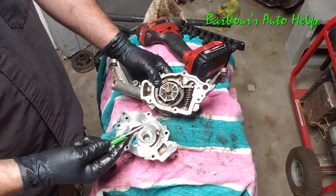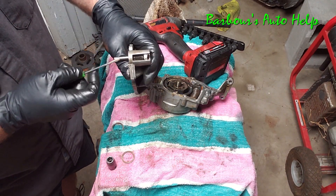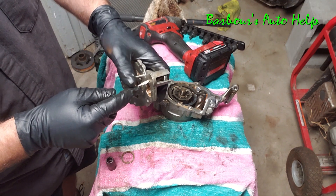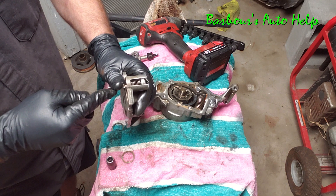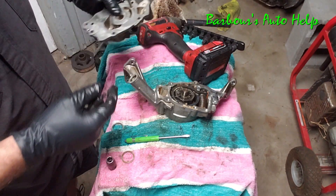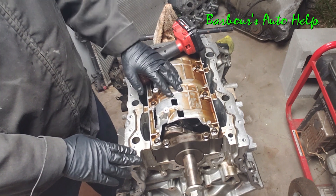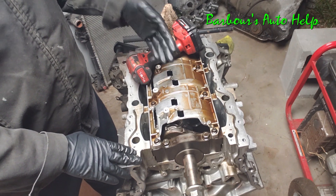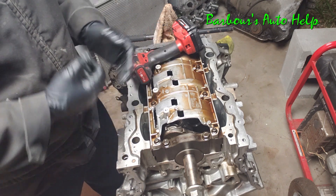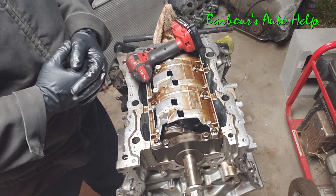This part of the oil pump rocks back and forth inside there and that helps to regulate oil pressure. There is also a regular oil pressure regulating valve right here inside this high-pressure passage — a little check ball — and when the pressure gets too high that check ball will be moved off its seat and dump excess oil pressure back into the oil sump. I'll post more information in the description and links to other websites for more detail.